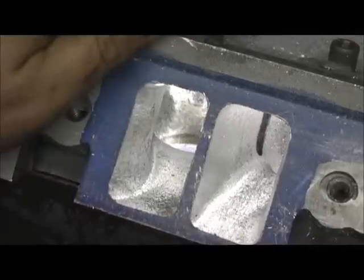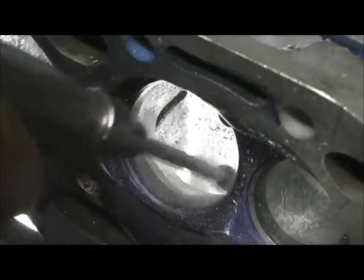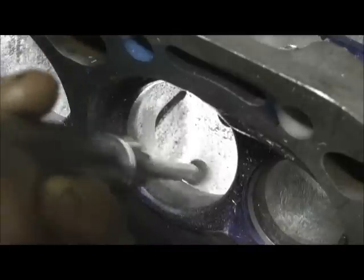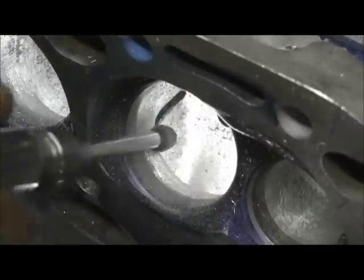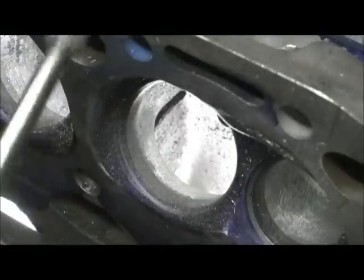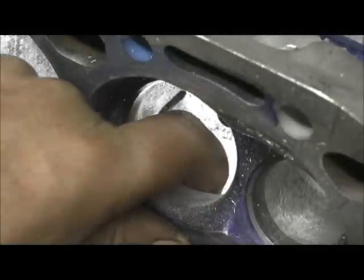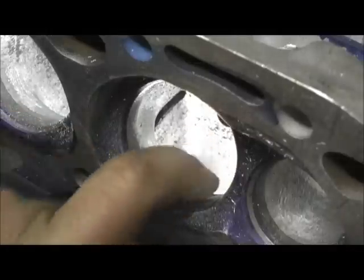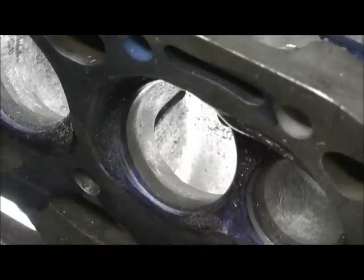I'll have to repeat this motion as many as four or five times. I'll hit it again — I just turned it around the other way now. It feels a little better; I can actually feel it rolling now. The shape of that stone is so important — if it isn't radiused and rolled right there, it will not work. I've taken my finger and I can feel that sharp edge is totally gone, but it still has just a little bit of a high end radius to it. I'll show you how to hit that with a sand roll from both sides — going back and forth.